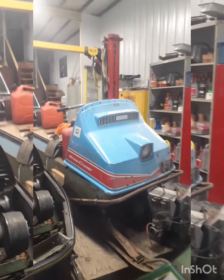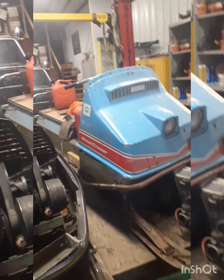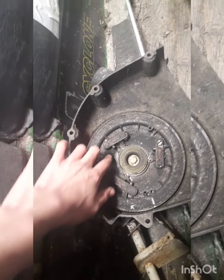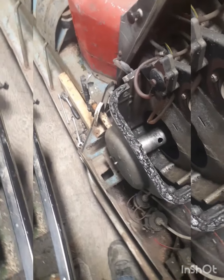This is part two of the snow cruiser snowmobile. We got her inside the shop — it was getting a little too cold out in the lean-to. We're gonna see if she runs. First thing we need to do is take the pull cord off, because it's not latching into the crank. We do have another one. I think these latch into the crank when you pull on them. So we're gonna take this pull cord off — first step — get the other one on, and see if it cranks over. I think there are about five or six screws. I got it off pretty well; I just gotta take this mount off. It does crank over — it's not seized.